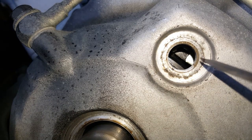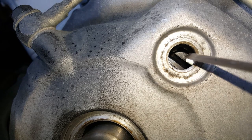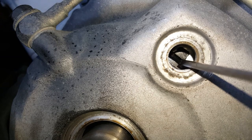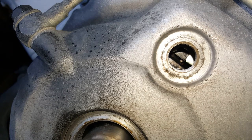As I rotate the engine, what you're looking for are markings on that flywheel. We're looking for a little vertical line and it should line up with that little groove in the casing. I'll rotate it around slowly — you can see some little numbers, batch numbers and stuff on there as well.